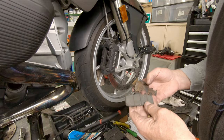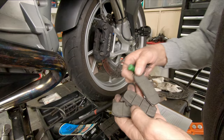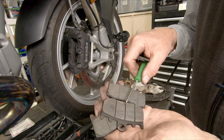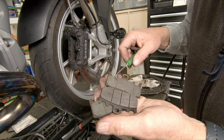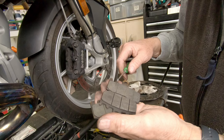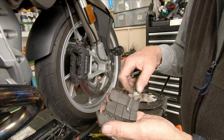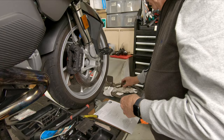Here's an example of some older pads that have been on bikes. This one is worn down excessively — one side is worn almost to the wear limit of the wear groove and the other side is still showing a lot of depth. This is irregular wear from side to side on the front brakes. It's not acceptable. You have to find the problem: why did one side wear excessively — is it doing all the braking, or dragging, while the other side isn't? There's something wrong that you have to investigate by looking at the evidence.